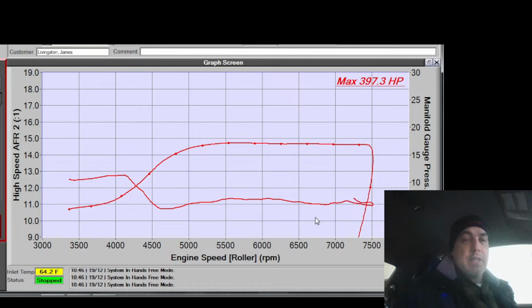Let's see. Let me look at that SD table for VE and see where it passes through as it starts. Maybe I can pull some fuel out of it. Man, it doesn't look like it's that. But let's do it anyway. So let's do it one time. Key back on. I'm going to trace it like that, and I'm going to log it. Yeah, it's not that.